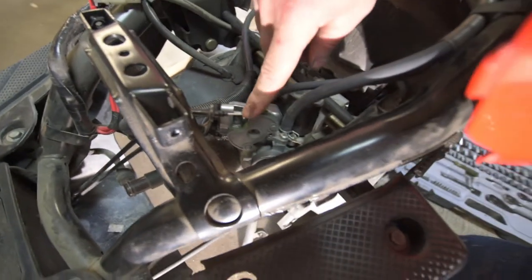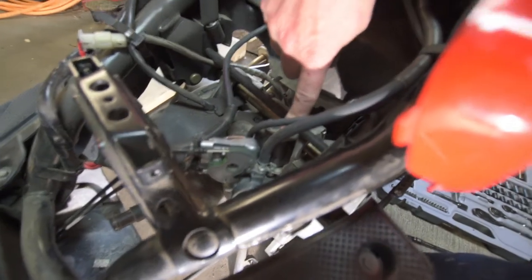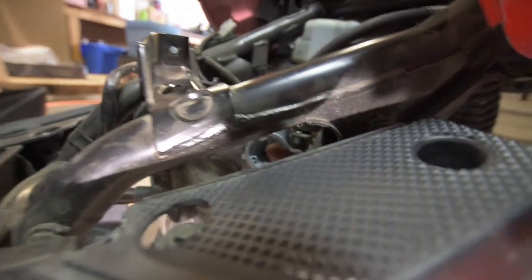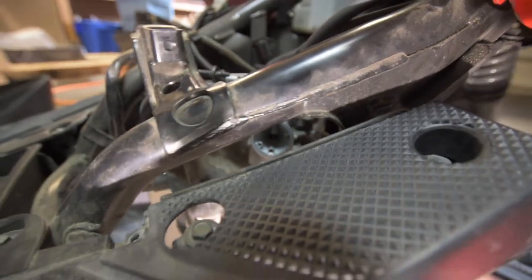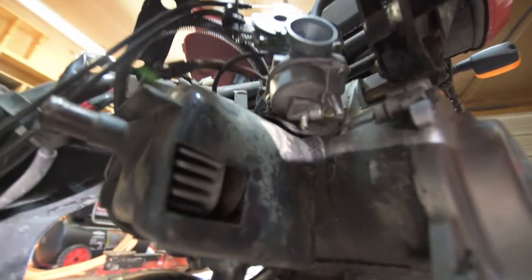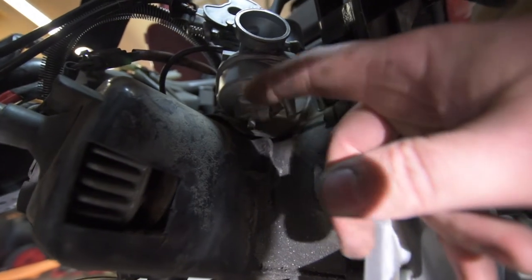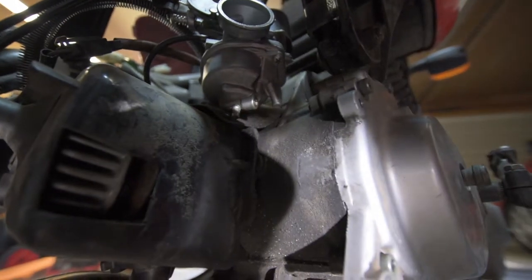On the BWS, this is the carburetor here, throttle linkage, and this is the automatic enrichment device right here. In through here is your intake, and up underneath here is your float bowl. I need to take that off — that's where the main jet is — so that's what I'm going to be working on.